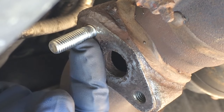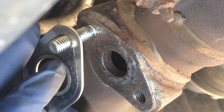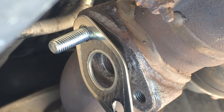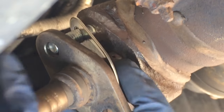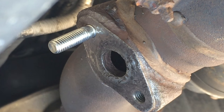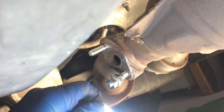If you're working with a slightly different stud dimension and think you might be sticking out a little too much, before you install your second stud go ahead and swing your gasket on and have a look with the oxygen sensor in place to make sure you indeed have threads to accept the nut. So when we put a nut on, it's going to be onto threads and not onto a non-threaded section — depending on the type of stud you're using. You shouldn't have that problem with these studs or OE studs, but just double-check. We'll get this other stud in — same deal as before, 13mm.